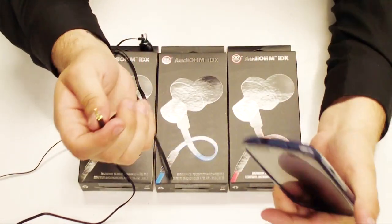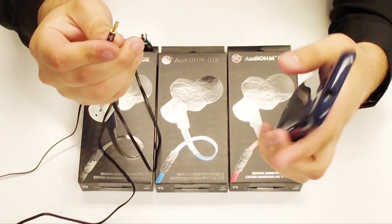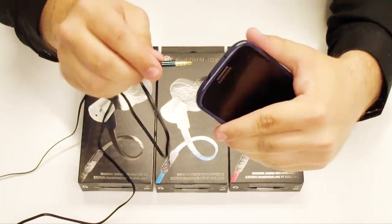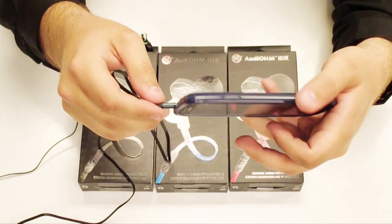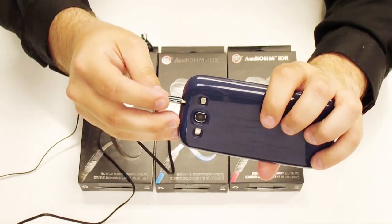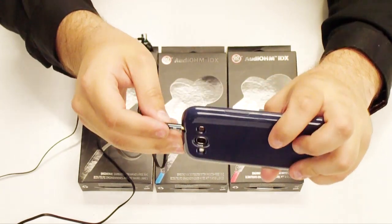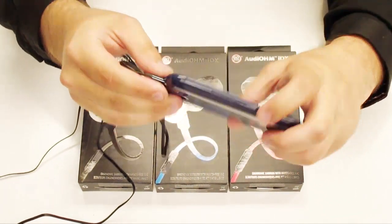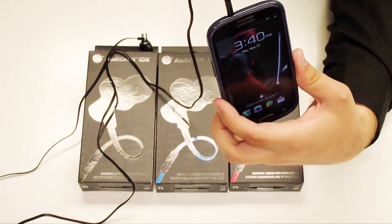Possible troubleshooting tips. With these headphone jacks, a lot of phone devices have cases on them now. If you're not getting any sound, you'll want to make sure that it's all the way inserted. Sometimes on Apple devices or tablets with cases, it'll seem like it's inserted but you won't hear any sound. Just give it one good push, make sure it's all the way in and you'll be able to get your sound.